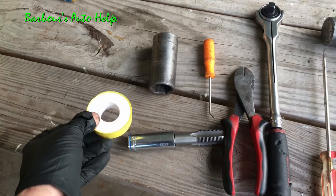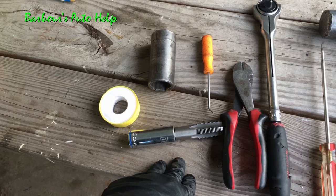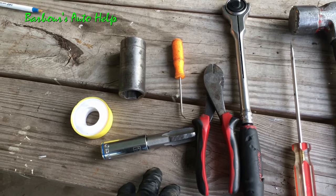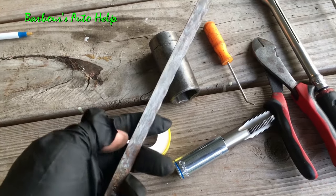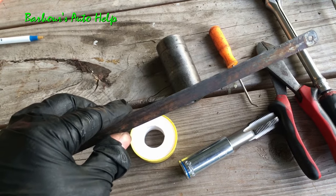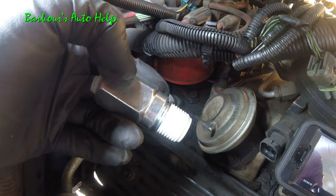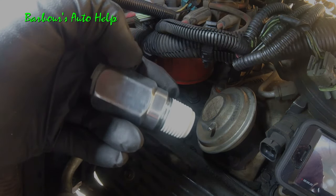Also get some Teflon tape — just in case you gouge those threads when taking the outlet out or getting the foam material out. That'll give you a little added forgiveness. The outlet does come with thread sealer on it, but the more the merrier. You'll also need a hacksaw blade — wrap a rag around one end while you use the other to cut. The replacement part is a GM coolant outlet available at most part stores in the help section; your parts professional can help determine the exact part you need.